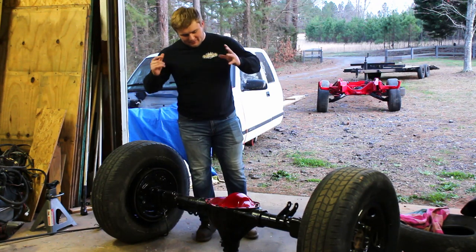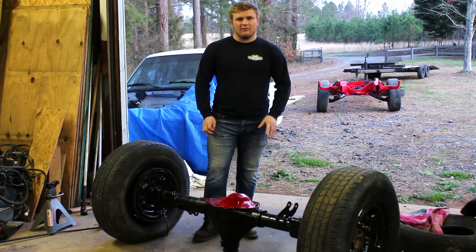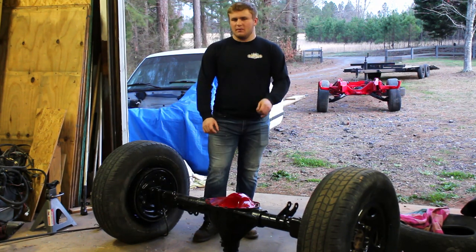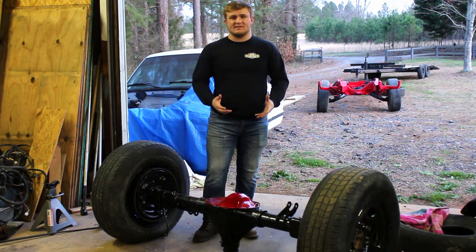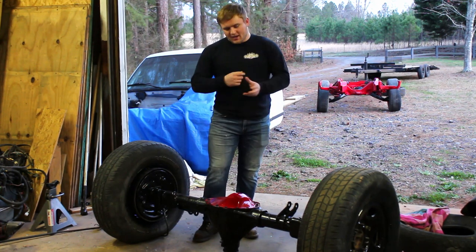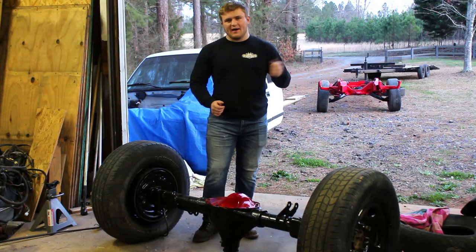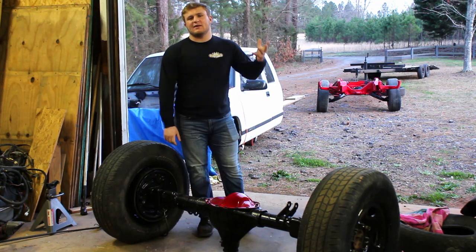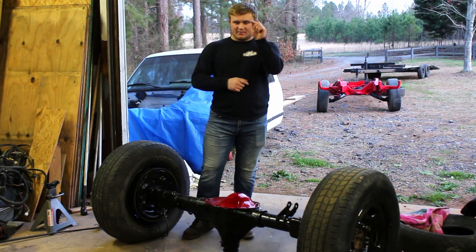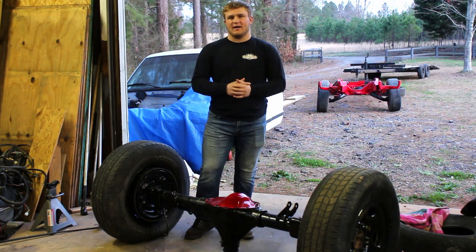Reflecting on how the axle build turned out, it wasn't quite perfect. I made some mistakes. Y'all saw I ruined the pinion gear. I had intended on staying at 373 actually, but I ruined the pinion gear when I was taking it out because I threaded on the nut and flattened the threads. So that was unfortunate. Then while taking the races out, I chipped the edges around the race and I ended up having to sand that down and file it down.